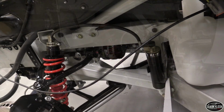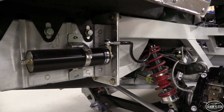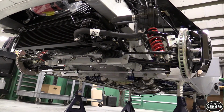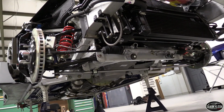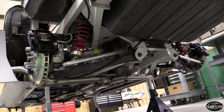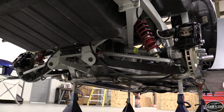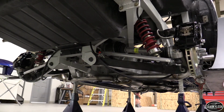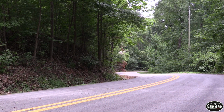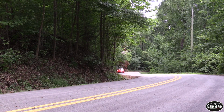A recently updated suspension consists of fully independent tubular steel upper and lower control arms at each corner with coilover springs and double adjustable nitrogen charged shocks. A hollow front sway bar keeps things tight around corners, while revised bushings improve ride quality over earlier cars. The ride is stiff, but it's never punishing. The adjustable shocks allow for fine-tuning for firmer or relaxed setups. If you'd rather save some money and go for a fixed damper setup, that's easily done.